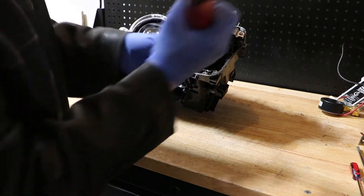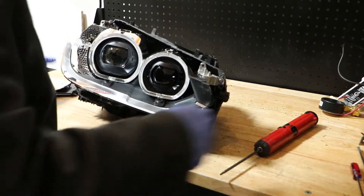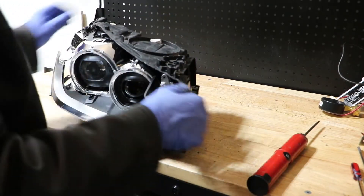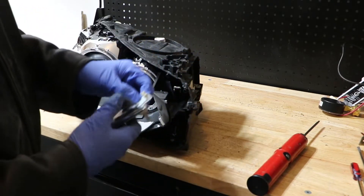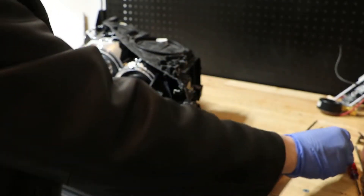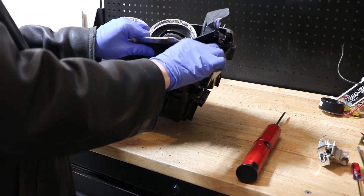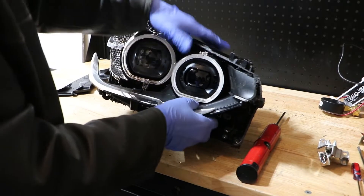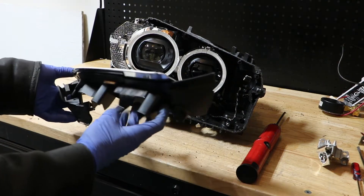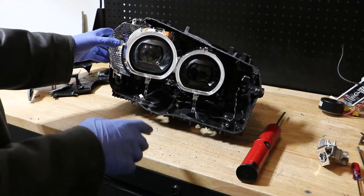One in the middle and then one on the outside corner. There's actually one more here on the inside corner. Looks like I may have to remove the inside right here. So we removed that one T20 screw and then that came out. There's a little wire connector here — here's the wire clip holding on the inside light. So there is one more, a fourth T20, and with that fourth screw holding the bottom on, we can now remove the bottom bezel.